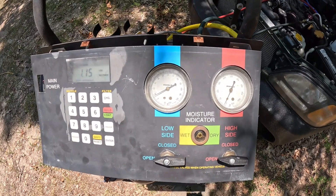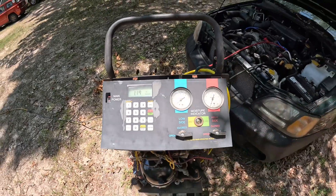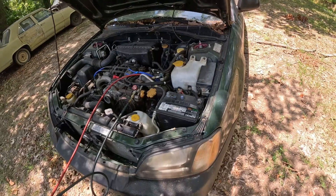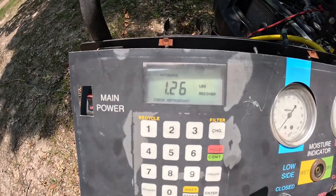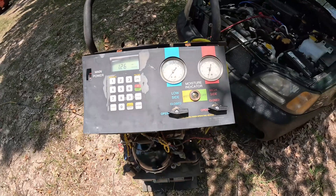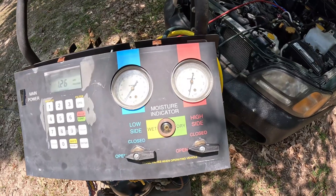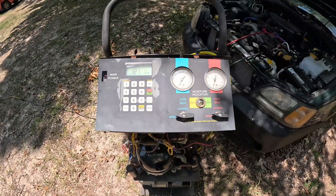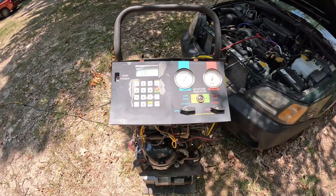Okay, pressures are coming down. We've got over a pound recovered now — that's excellent news. There's no smoke, no smoke smell. It's a shame that the car won't have air conditioning, but the motor not running has that same effect. Oh, and of course we're recording so turn the sirens on. One and a quarter pounds added to the 0.11 that we got off the other vehicle, which mostly was just a charge for the machine. We're at over a pound stored — about eleven dollars worth. That kicks butt. This is going to kick off pretty soon because we're getting down to where there's nothing left. Just the fact that it's all doing what it's supposed to do — it's a good machine. I'm so proud of you.